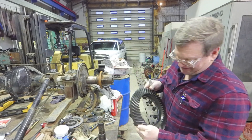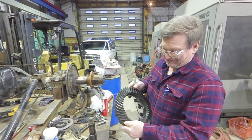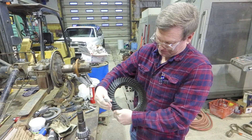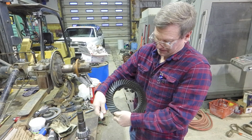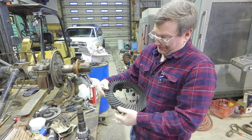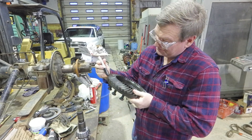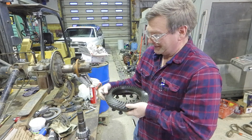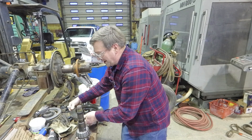Back to our ring and pinions — if we look at this, you can see a real pattern. This is not with paint or anything else; this is a real pattern on a used gear I just bought. You can see the shiny part where it's been wearing — lots of contact area, nice and smooth on both sides. Nothing missing. That's the way it should look.